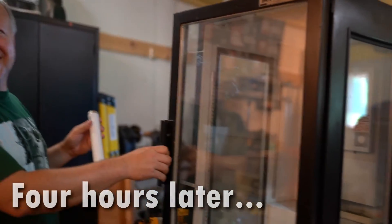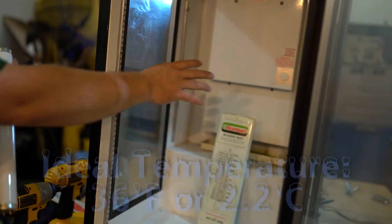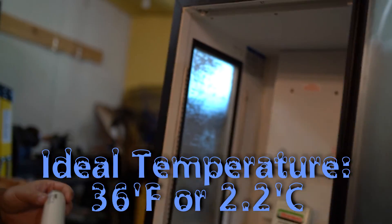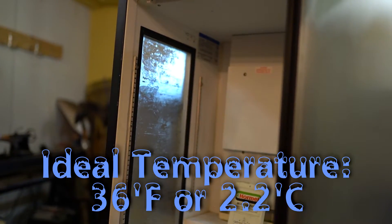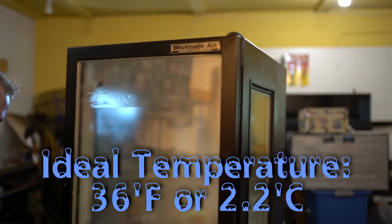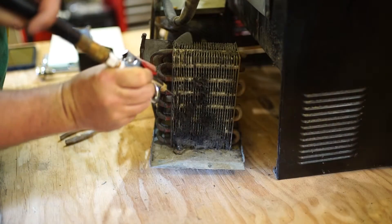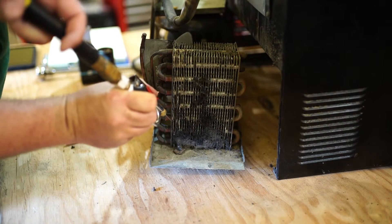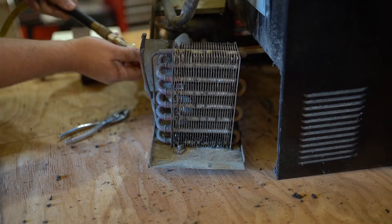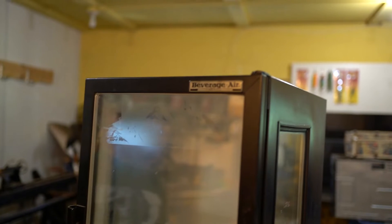We've been gone trying jet skis. It's at 45 degrees — it's cold in there. While encouraged by the refrigerator's ability to now cool, we were underwhelmed by its ability to achieve the ideal refrigerator climate. Let's start by cleaning the condenser coils, which will improve heat exchange. While heavy debris removal appears visually dramatic, it didn't improve the refrigerator's temperature.